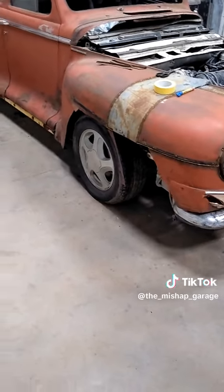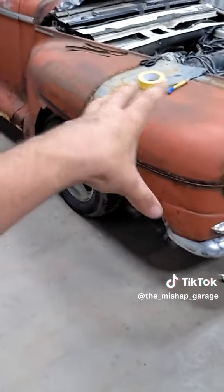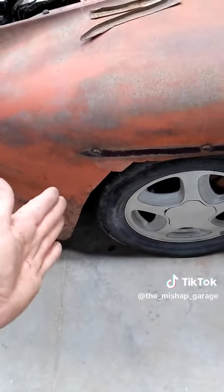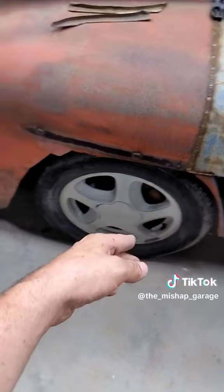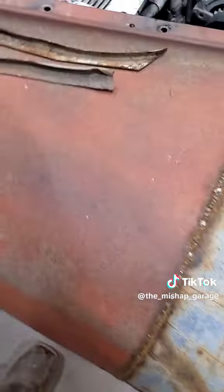I don't know what part this is anymore. In this video you will be able to see this entire fender get finished. What I've done is I've chopped off the back because the fender — the Buick sits too far back — so I chopped it off. I'm going to match this gap; I welded that piece on right there, and then I'll set this to match it so that wheel is centered in that wheel well.